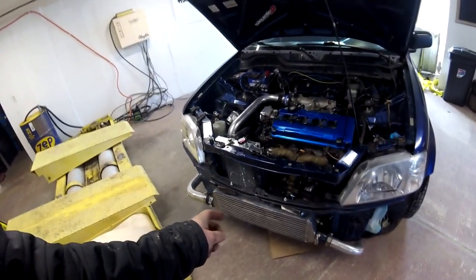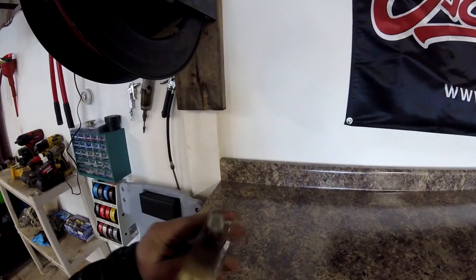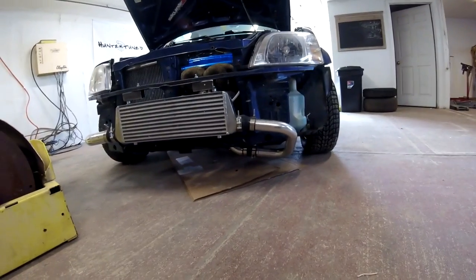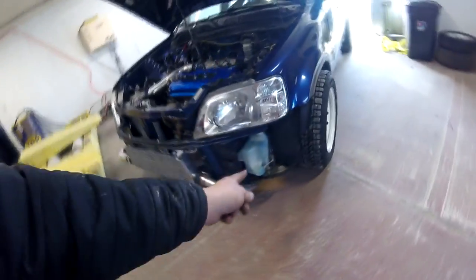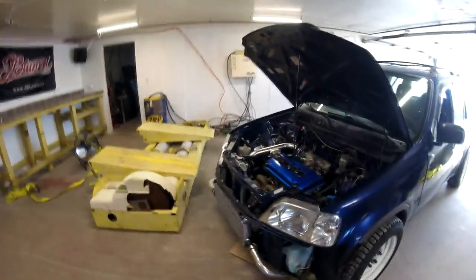The car doesn't have a downpipe currently — he gave me the flange and the clamp, so I'm gonna have to work out a downpipe that I'll need to make for it. The intercooler piping needs to be situated a little better because currently the piping runs underneath the car, which is definitely not the best way to go about it. So I'm going to be deleting the washer tank and trimming the inner fender well so the piping can sit up and the bumper can actually go back on.